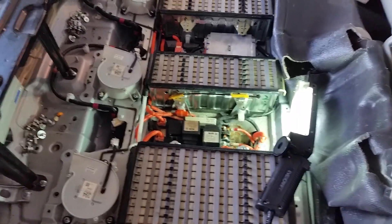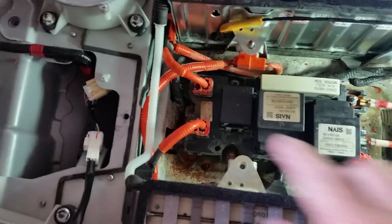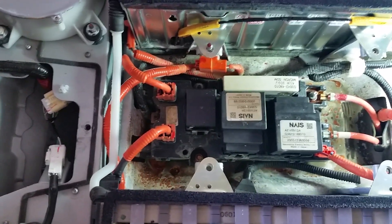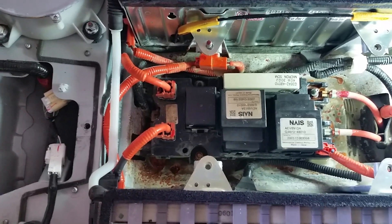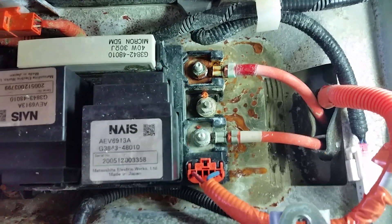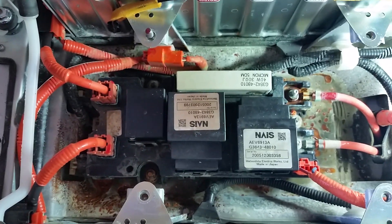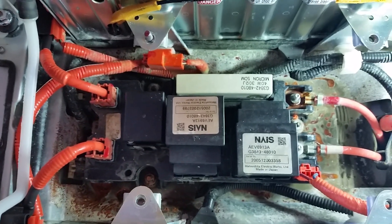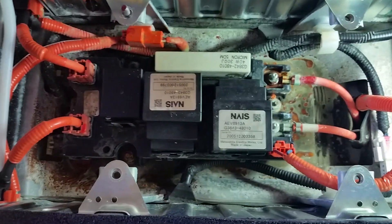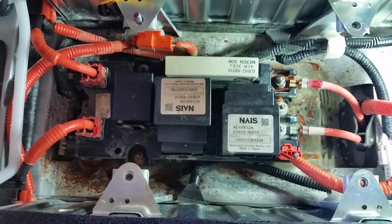This is the battery compartment. These here are the battery packs. As a side note, whenever you see wiring that is orange, make sure you use a lot of caution around that, because the orange casing is an indication that we have high voltage in those situations. There's a lot of corrosion down in here in the bottom of this compartment. This piece in view right now is the relay set for the high voltage system. Basically what happened is where the high voltage wires exit through the floor of the car, when the car got deep in water, water came up in here, filled this compartment, and the corrosion destroyed these relays. A pretty tough day at the lake for our friend here.